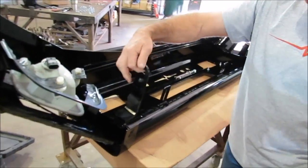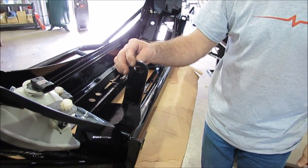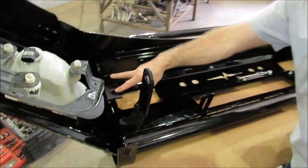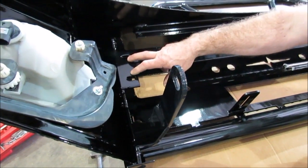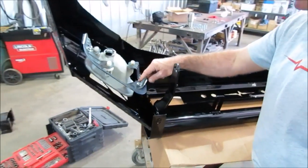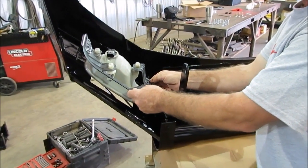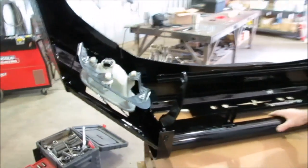This little piece right here is what's going to bolt to the bottom bracket that we just showed you how to put on the back of the frame cap. There's actually a little shoe right over here too that's going to bolt to the bracket where we took the tow hook off and put it all back together. Your fog light — you can see there's going to be a bolt on each side. There are little brackets welded into the front end. When you leave your factory fog light bracket, you just bolt it all onto your front end at the same time.